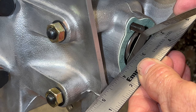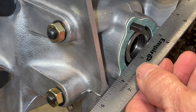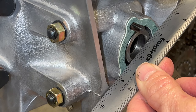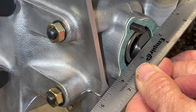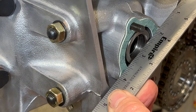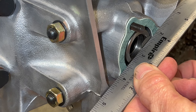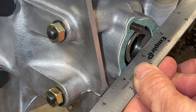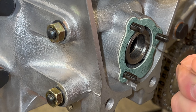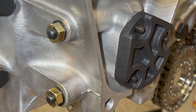So this is the Victor Reinz gasket that was supplied with our kit and this is going to be almost right on the money. You can see if we put our straight edge against there we now have some end play in there, but there is going to be a certain amount of crush on this gasket when we torque it down. So what they're talking about is after you have your crush, your end play needs to be within those specs. With our situation, the Victor Reinz gasket alone with no shims looks like it's going to be the correct measurement. We're a little bit on the thin side, but by the time we get our gasket crush we should be okay.